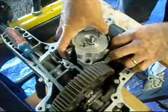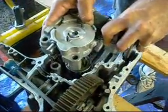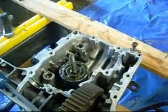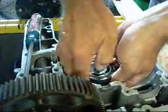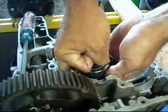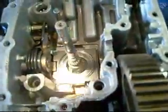I know this is spring-loaded and I'm going to try my best to carry it off in one piece over to the work bench. Finally, after getting that center case out, it's time to now remove the pump. There's a technique to this so the pistons don't fall out of the cylinder. That goes over here to the parts table as well — that will be our pump. I'm very happy with the non-amount of metal in the top of the case. Feeling good about that. I'm going to assume the problem is with the pump and motor kit.